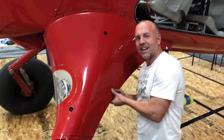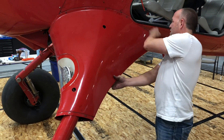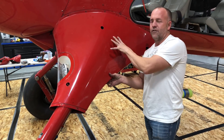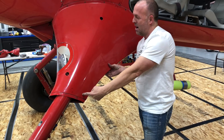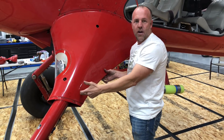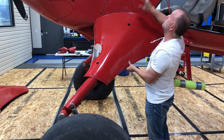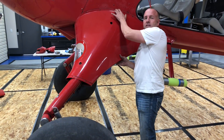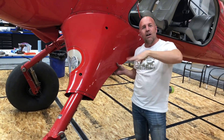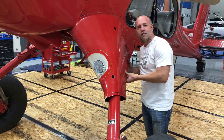The way we're going to take care of the fuel system is I need to make sure I don't port the fuel. This shape here is going to be like a header tank for the left wing and another one for the right. The fuel pickup will be here at the bottom, and then it won't matter what attitude I get in - I will not be able to port that. I can tip it at any angle; this tank will be filled from that tank so it will always be completely full. I want to be able to get wild in the turns and landings. So the idea is I'm going to start with two fuel tanks.